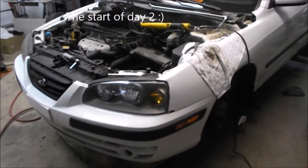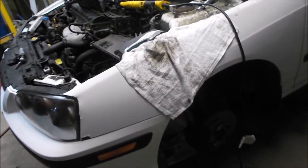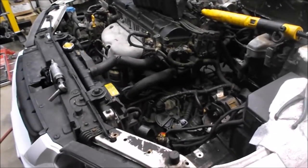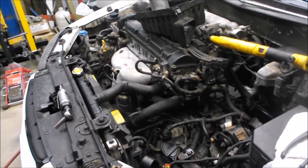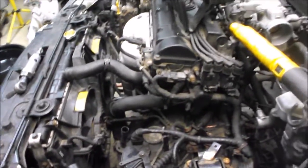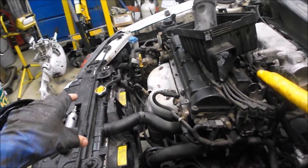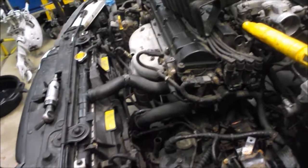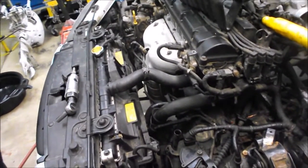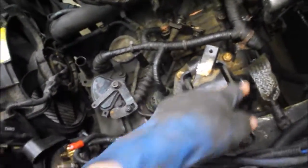After a 14-hour day yesterday we decided to give it another go. After the previous segment we set the transmission on a sawhorse, then lowered the car on top of it and gently wiggled the transmission into place so the dowels lined up, then bolted all the transmission in place. We had the 4x4 post across from the firewall to the rad support so we could raise the car from there. That post took the weight of the engine and transmission, we got the sawhorse out of the way and fully bolted up the transmission. We installed the axles back in with axle nuts and cotter pins — this one still needs to be torqued.